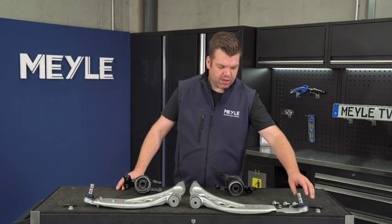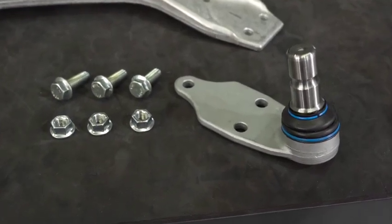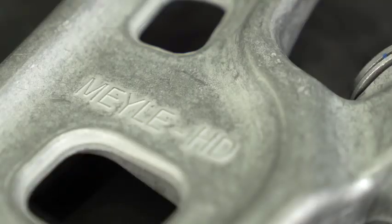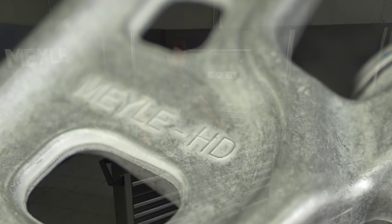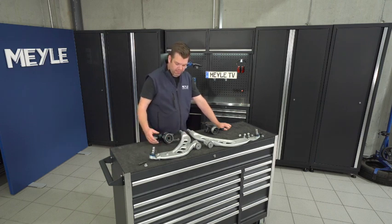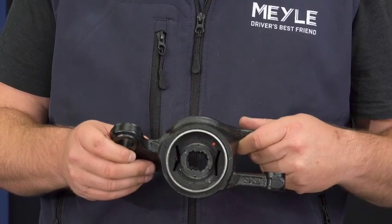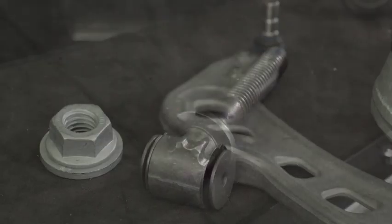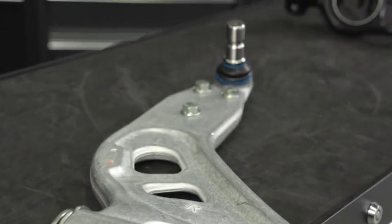We also have a separately interchangeable ball joint, and the ball diameter is increased — also typical for an HD product. The kit consists of the pre-assembled control arm, as well as the rear bushings and the clamping bolt at the wheel carrier. We have given the part to an independent technical checking facility, the TÜV Nord, and after they performed their own tests, they confirmed a much longer lifespan compared to the original part.